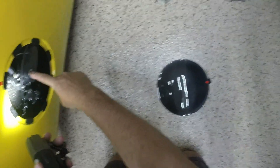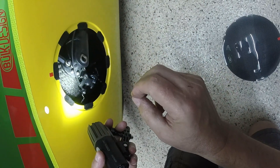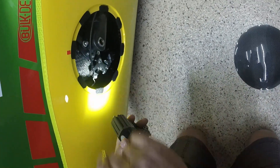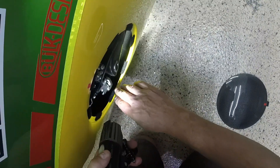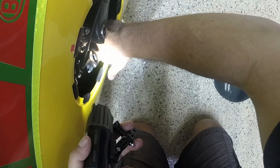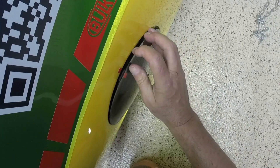There's a special tool because this is a single swing arm — so it's cantilever. This is the axle that goes on, and there's a special tool for removing that. You pull the axle partway out, it drops the wheel, and then the rest of the way out you can get the cassette out. The problem is the derailleur hanger that comes with the new 11-50 cassette exceeds the capacity of this derailleur. Also, as you can see, there's not a lot of room down there in the bodywork. So when the derailleur pulls forward, we want to make sure it's not going to hit the bodywork with that big 50-tooth. When I measured it, it looks okay, but then looking at it again I went — maybe not. So we'll go have a look at the cassette.